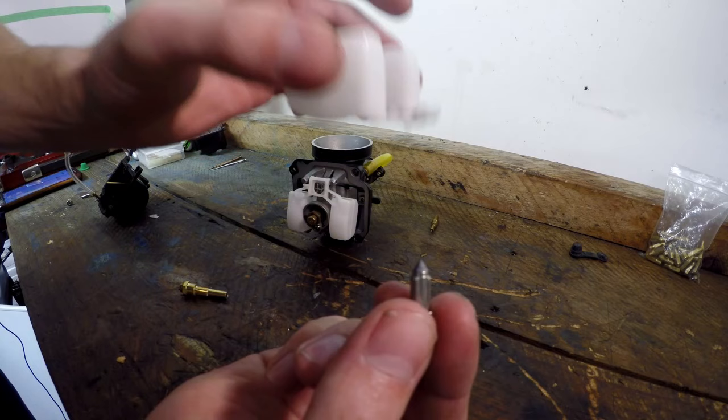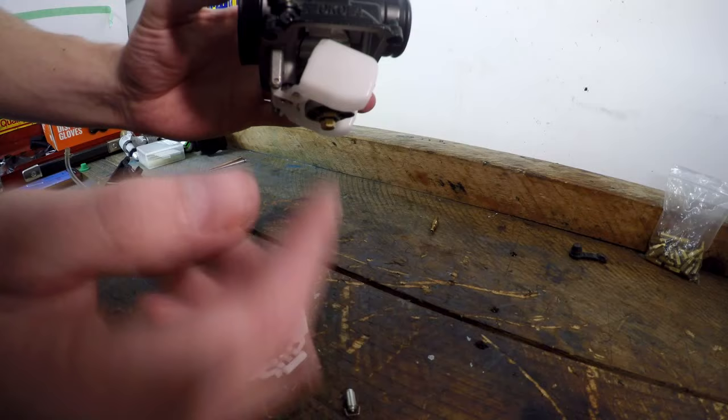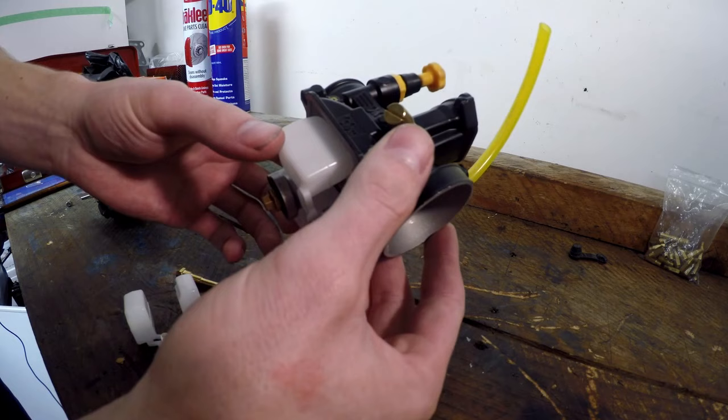The amount of petrol you want in here is enough that it's not going to starve of fuel at wide open throttle — enough fuel going into the venturi and into the motor without running out of gas. The easiest approach is to have it as close to the top as you can get without the body of the carb causing it to close prematurely.